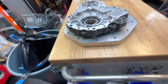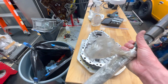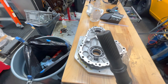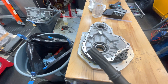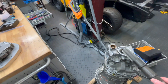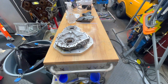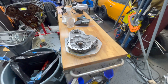Here is a shaft out of the G35X — this is the correct spline pattern. Obviously everything else on it is wrong because it's out of the transmission itself; it's the main output shaft for the G35X transmission. But something like this that adapts from the output here to the input of the transfer case is what we're going to be doing. We'll get something like that made. Well, that's all the updates for now. Thanks for tuning in and until next time.